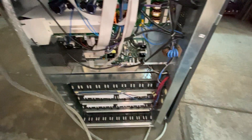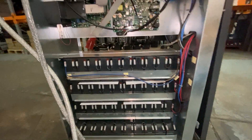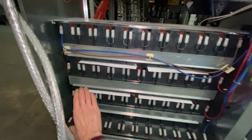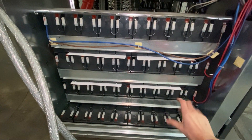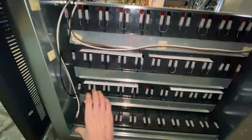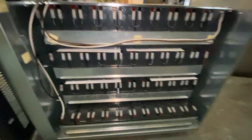The batteries are in 240 volt strings and they operate in two strings. There's one set here, another set here, and that is in parallel. So this side mates with that side and makes a parallel pair, and this side mates with the side at the bottom on the other side.